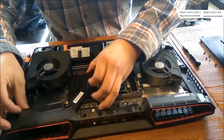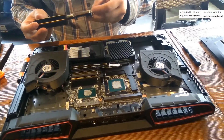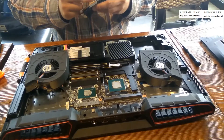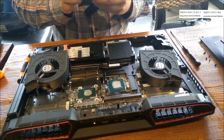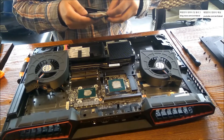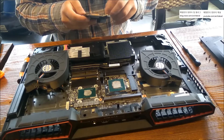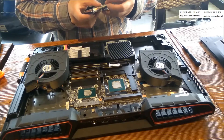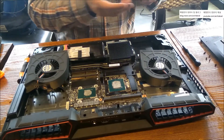You don't have to take it off completely — just take off four screws. For the green silicon thermal pad, you don't need to replace it. Simply leave it in place. At the same price, you don't have to take it off. If you take off the thermal pad your laptop temperature will be higher than expected, so just leave it — attention: don't take it off or throw it away.